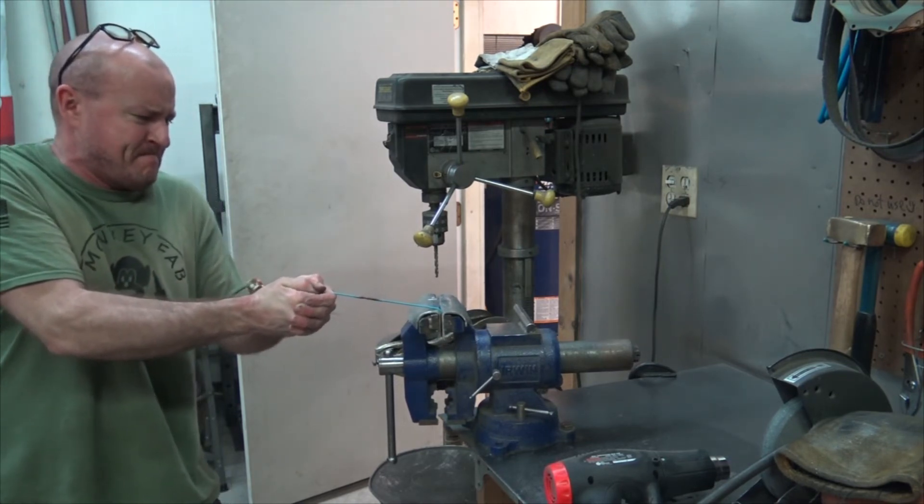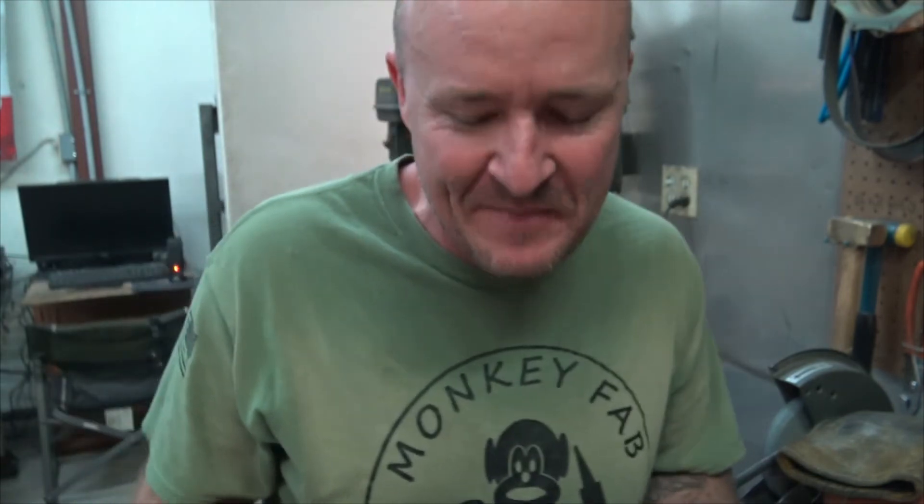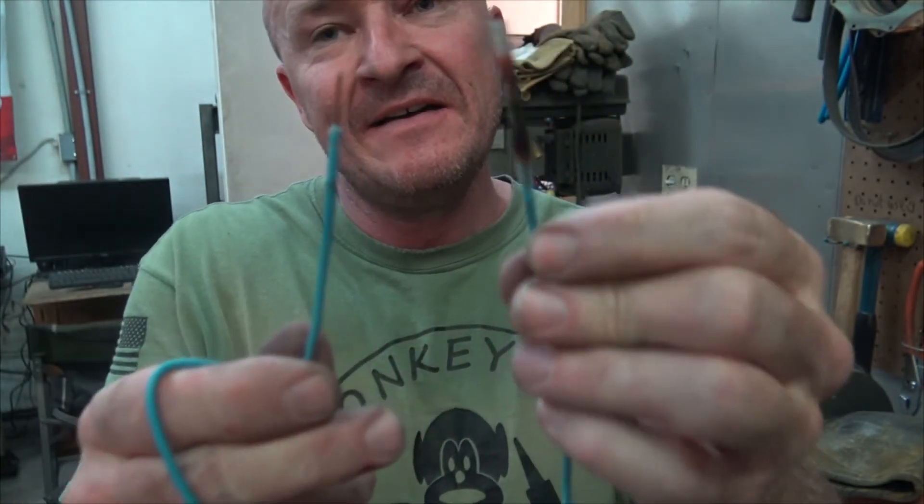So that was actually more — maybe like 35 pounds — but yeah it still ripped at the joint. That should be pretty good though. If you have any kind of weight dangling by your wires then you're probably doing something wrong. The idea is: let the solder set up, make sure you got them wrapped together, put it in there, make sure the solder actually liquefies and seeps into the wires, and then let it cool before you start yanking on stuff — and you'll be good to go. Thanks for dropping by and checking out the video. If you want these, the link is below, and until next time this is Mike, Monkey Fab signing out.